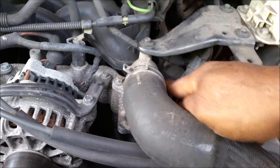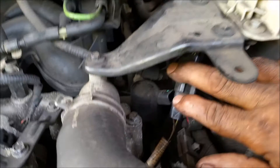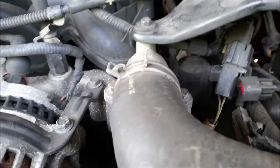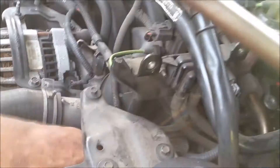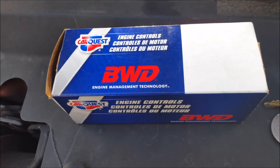To fix it, we're going to swap the ignition coil. Screw it up, pull the ignition coil out — you need a 7 millimeter or 8 millimeter socket. Reaching through here past the power steering bracket, get the bolt out of there. Got the hole right there — okay, got the old coil out.